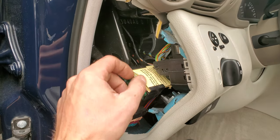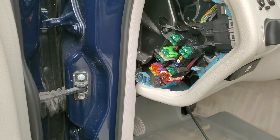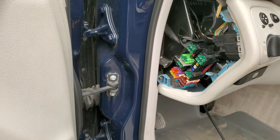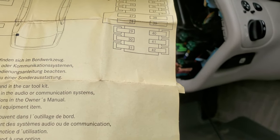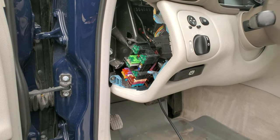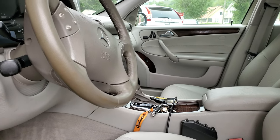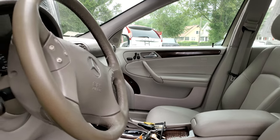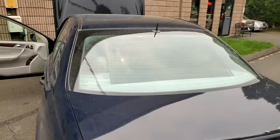One of these green fuses is for the seat — this one here. Here we have our write-out for the fuses and I'll tell you exactly the number: this was fuse 38. This powers the computer for the passenger seat. The car has electric memory seats and the module was not going to sleep. That module has a fault — it's very common on W203s for the seat computers not to want to go to sleep.